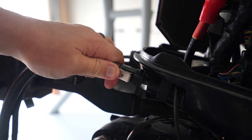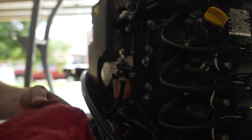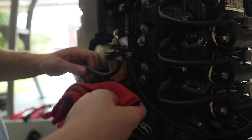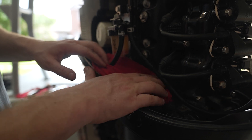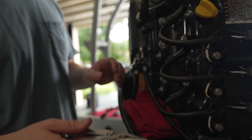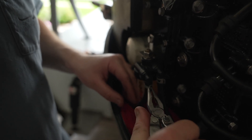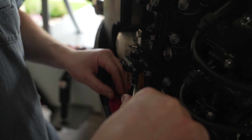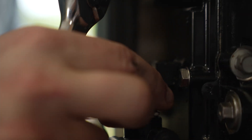This is set up with a quick disconnect, so we're going to go ahead and just disconnect our fuel line. We've got our rag — we're going to set it underneath because these lines are going to have a little bit of fuel in them, and we just want something to catch that. Take our needle nose pliers, just squeeze and work them down a little bit. Then we'll grab our 13 millimeter socket and disconnect the bolt on top.